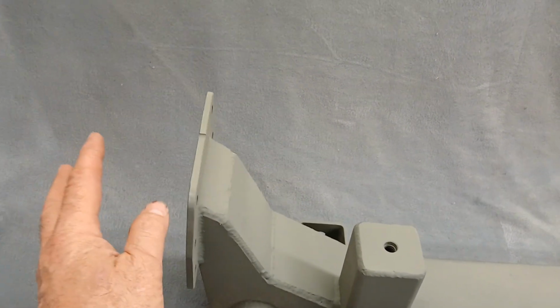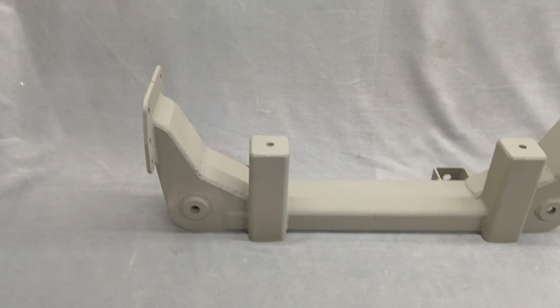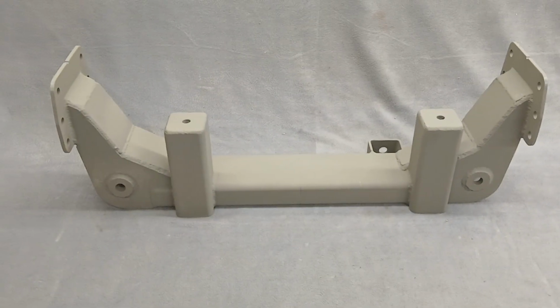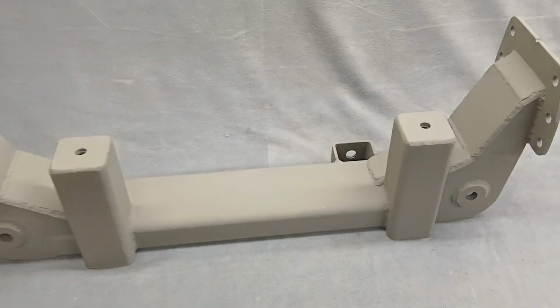But if, let's say, you're using 2x4 rectangle tube to make your frame, if you're 34 wide on the outside, that means you're 30 on the inside. That means this is an inch too narrow. Now we make a stub end version where these come out another 1/2 inch on each side, but everything else is the same.